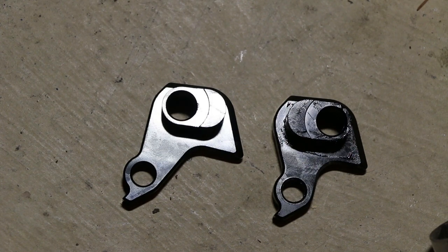Just a quick comparison between the two hangers — the one that just came off on the right and the new one on the left. You can see the axle position on the right hanger is more to the right, and on the left hanger it is more to the left — left being long, right being short. We're going to go ahead and put the longer derailleur hanger in with that 6mm hex and we should be good to go.